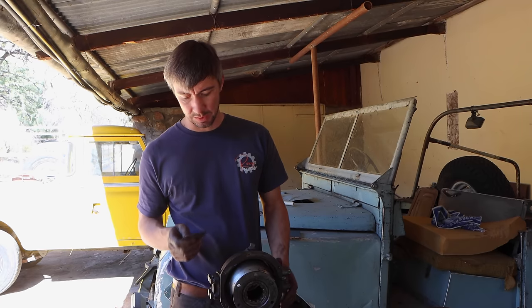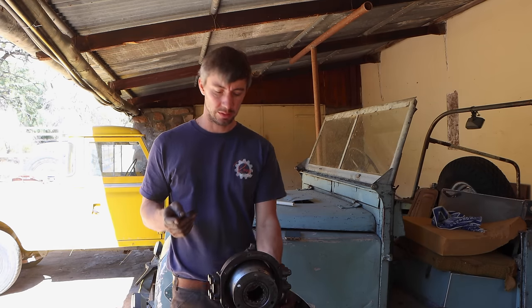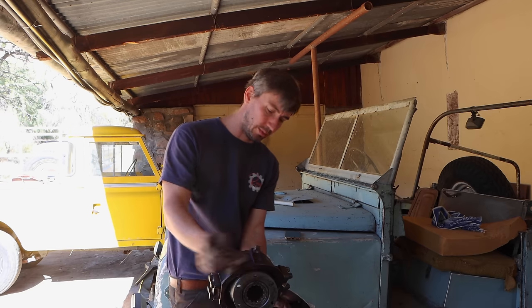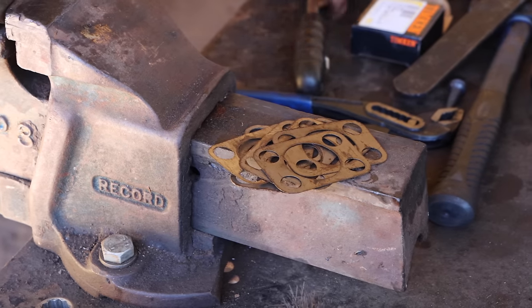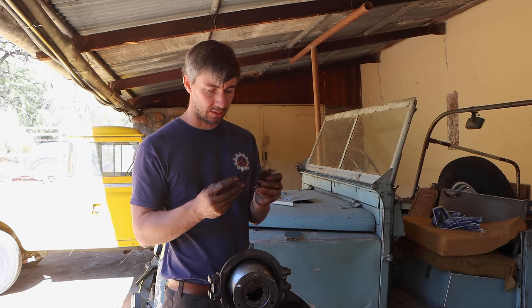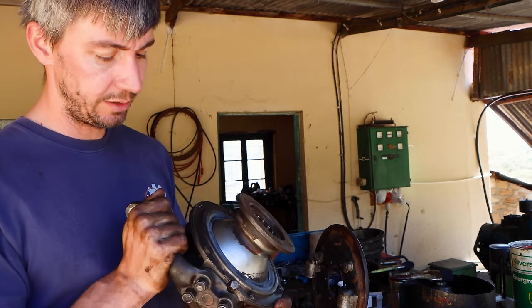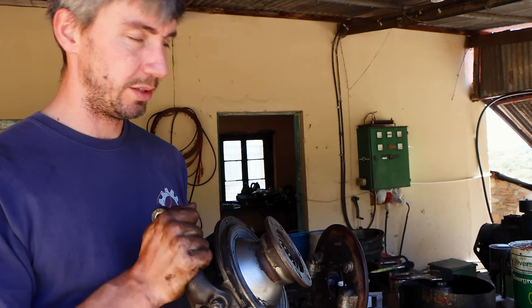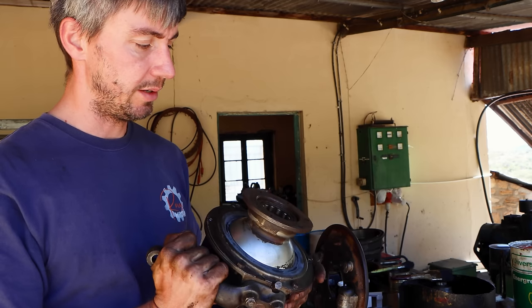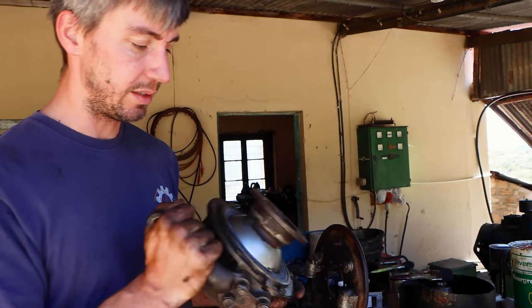The seat is way too stiff, that's why I need to play now with the shims to get it right so it moves a little bit more freely. I hope we have enough shims to build both sides, but we need to check. It's still too stiff. I fitted quite a few shims, but it didn't get much better, so I will put it in the car, have it sit for a while, do the other side, and then come back to this.